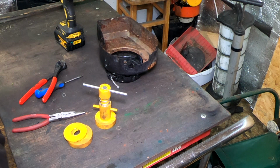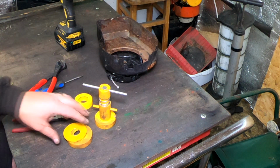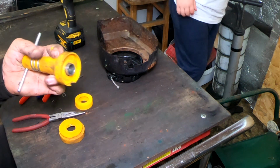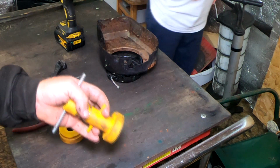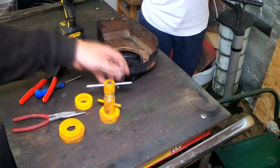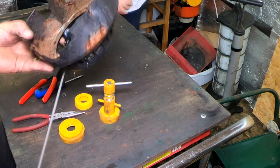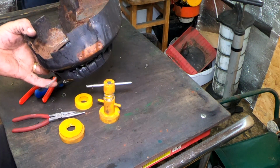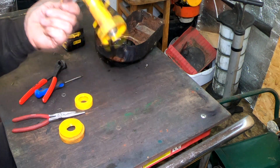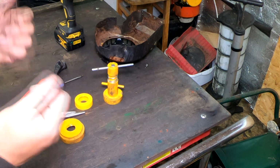two or three different sizes. It even comes with a really, really tiddly size too, tiny, tiny size. So just make sure you get the right size first for your recoil assembly. And you can use the, it's called the E-Z Recoil system for ejecting your springs into your assemblies. And once you get used to it, you can use that tool every single day of the week. And it takes you 5 minutes, literally, rather than mucking about with your thumbs and masking tape, electrician tape and mole grips and all that sort of stuff.